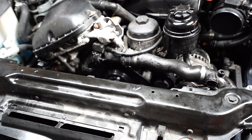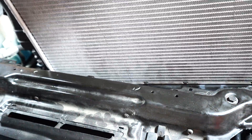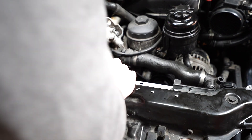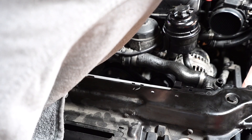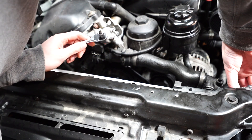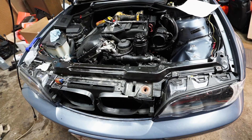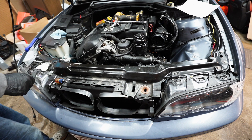We're now going to attempt to slide the radiator in — I did put the belt and pulleys back on first. With the radiator in, there's a short T25 bolt on the side of the expansion tank that we thread in now. The radiator is in; we just have to put both hoses back in, and that side is clipped in.